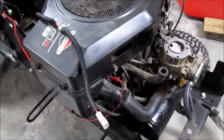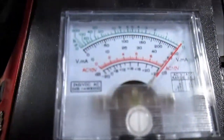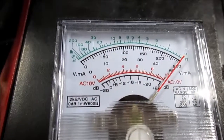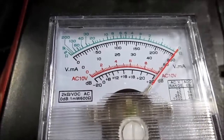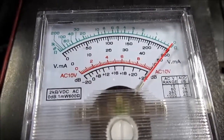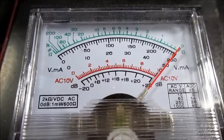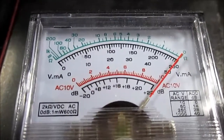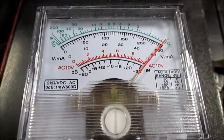I hooked the kill wire back up to the coil. And as you see here — off, on, off, on — no change. It's completely shorted, so it may not be the coil. It may be the connector or the wire. Either way, I've got to go into it. But hopefully the coil's good. I'll know more when I pull the top back off. Thanks for watching.